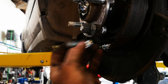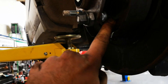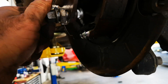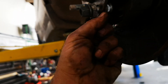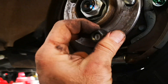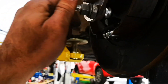He's got a broken stud, so I've ordered another stud. I've moved the hub down to this position here, put the new stud in, and then I've put a washer here — the owner's ringing me now — I've put a nut here to act as a washer for this bit, and then a suitable open-end locking nut here, and I'm just going to fire my gun or use a spanner to drag this nut through.